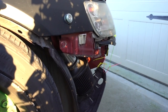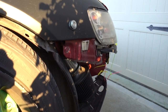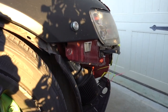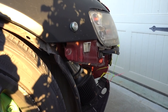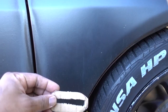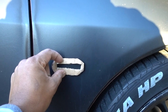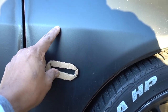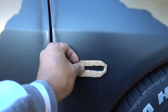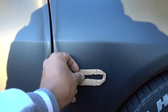This is one of the reasons why after doing the installation on the coilovers I didn't put my bumper back on the car — because you need to remove the bumper to get to the turn signal cables. Hopefully I finish on time today so I can put the bumper back on, because the ride height is pretty much done with the coilovers. So roughly this is where I'm going to put the turn signal. I'm going to measure from this top line to here and from here to here, so it's going to give me the exact measurement to replicate on the other side to get the turn signals in the same place.